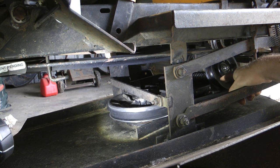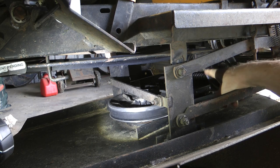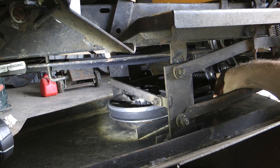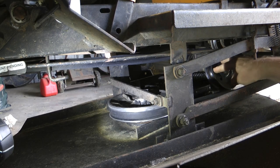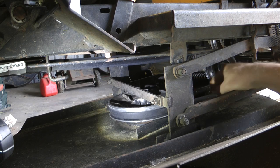To get it off these back pulleys, this is the adjustment pulley, the tension pulley, and that's your engagement pulley over that side. Two totally different jobs. That one moves, this one's rigid, doesn't move at all, but you can move the pulley backwards and forwards on the shaft itself. It has seven holes you can use. I'd say they're in the middle from factory, but going on the size of the belt, you've got three more positions to go back further to add more tension if this wears.